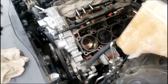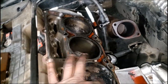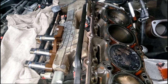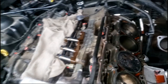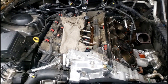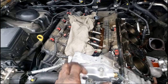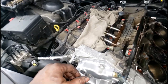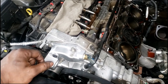That's how I did the last one, but I was so paranoid I took a bunch of stuff out. You can easily damage the radiator — you can barely graze it and nick it. Look at all this carbon buildup. Guys ask me about catch cans and oil inside the intake — what can you do to help prevent that? My thinking is: if the manufacturer thought the car would be better equipped with a catch can, they would have installed one. If you've modified your car and the end result is oil all in your intake, then yes, install a catch can. But straight from the factory on an OEM-equipped Hemi, FCA found no reason to add a catch can.